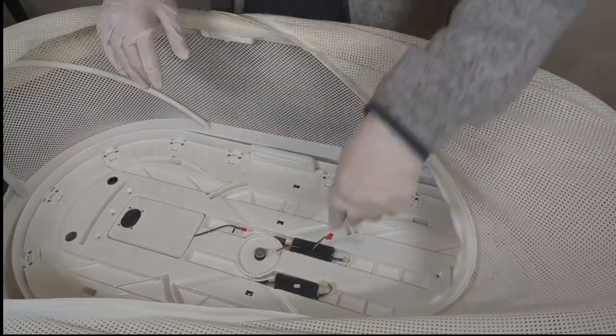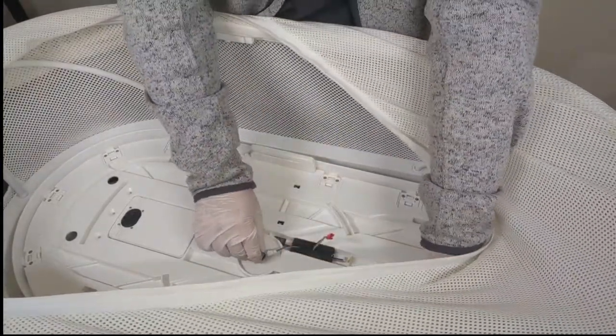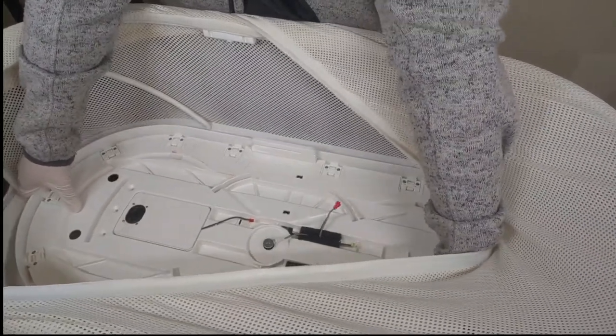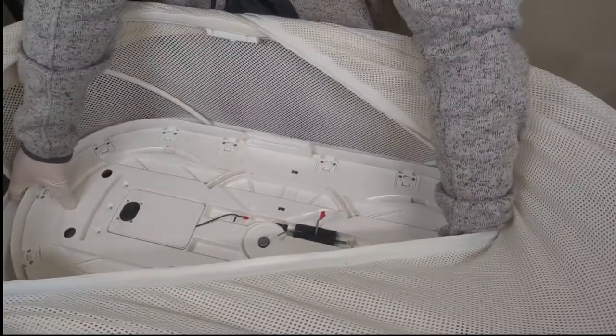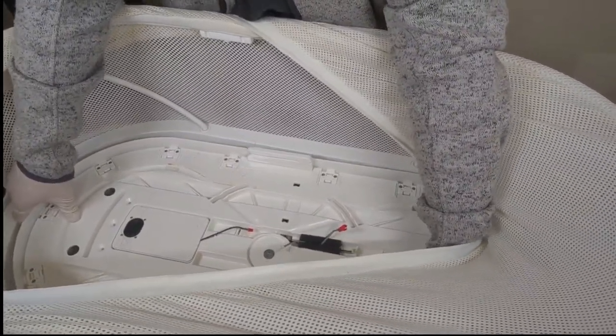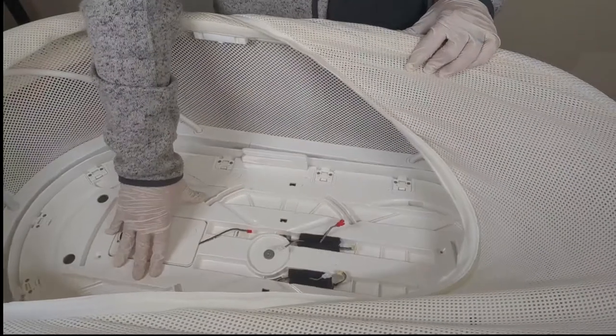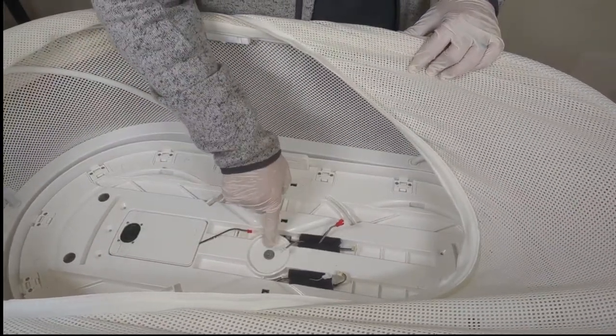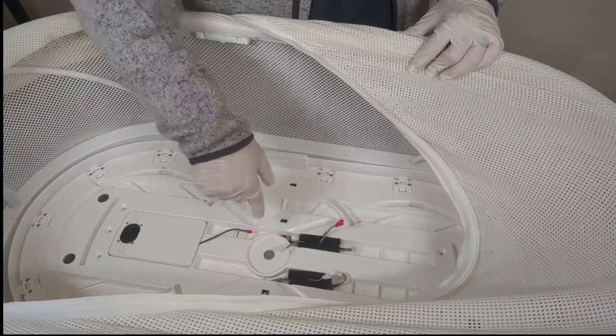Okay, now we have our cables through. We're gonna realign the center pin here. So we're gonna lift everything up, find that center point. Very lightly, we're gonna press it back down. You'll feel it's in the right spot. You'll be able to put it back to the usual motion the SNOO has. This center pin should remain in the zero position.